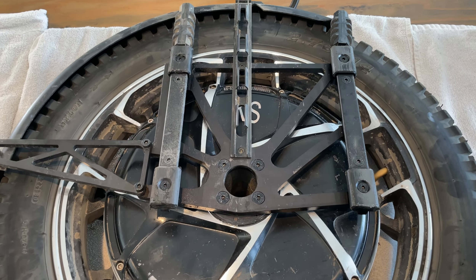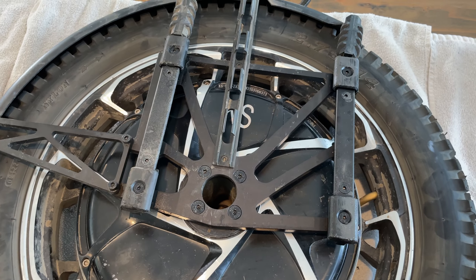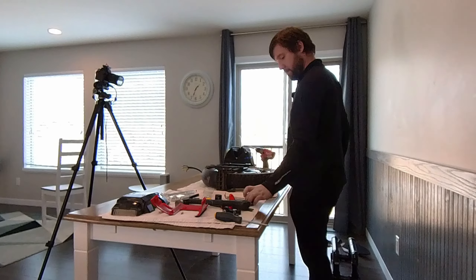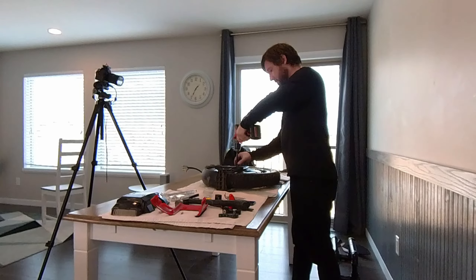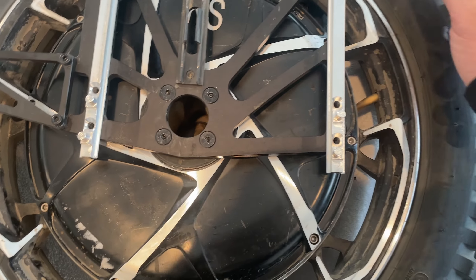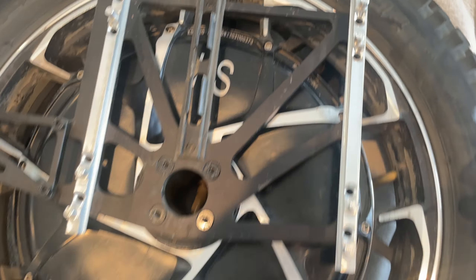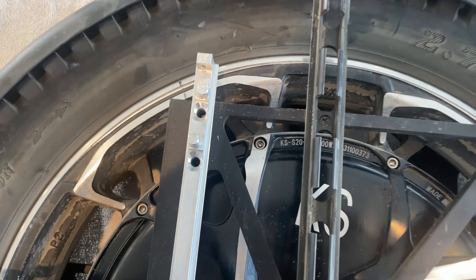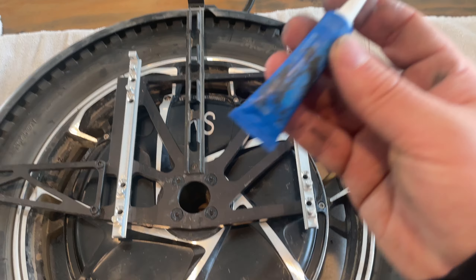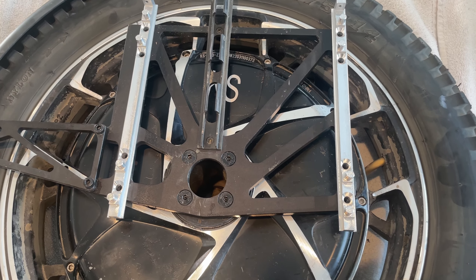Here are the sliders in their natural form — four screws holding them on, so we're going to take those off. I referenced Matt's diagram and this is correct. See how these are actually forward and backwards a little bit — we need the forward one to face forward. So that's the back of the wheel on both sides, one slightly ahead on each side. I'm going to use blue thread locker because we're metal on metal — we don't want these moving. Don't overdo it, a little bit will do.